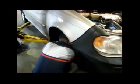He's going to start taking that tensioner off. He's going to remove the tensioner, which keeps a certain amount of pressure on the belt at all times. You can get down there on the ground and do this. We have the engine safely supported because the top engine mount is off. So be very careful if you're ever in this predicament — you've got to stick your body under there, so you want to be safe about it.